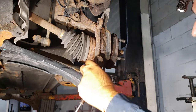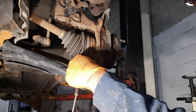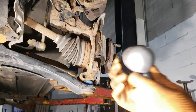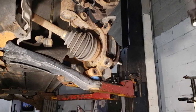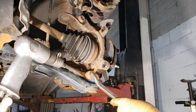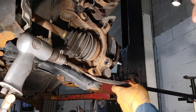Your next step is to try and see if the joint will separate. If it's not going to separate, you'll have to drive a wedge between the spindle where the ball joint is. Take a wedge and drive it in between the opening on the control arm. Turn the wheel just a bit to expose the slotted portion of the spindle so you can get the wedge in there easier. Remember, the goal is not to spread the joint until you break it — just get it in a little bit to take some pressure off the ball joint.